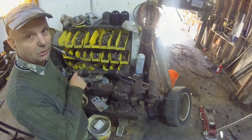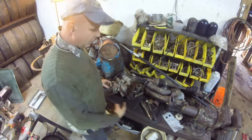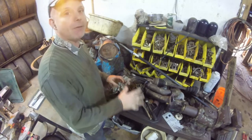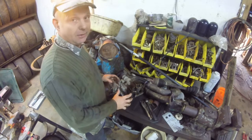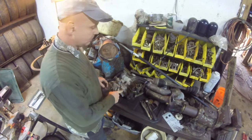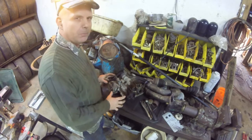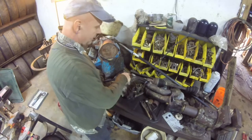Here's the transfer case. In their infinite wisdom, there is no fill port on the side of this transmission to change the oil. When I took the oil out it was goopy, black, and sooty. If you look on the web, everybody has a problem because they say this is 'lifetime use' oil — that is a bunch of garbage. If Ford or Jaguar said it's a lifetime thing and the component fails because you couldn't change the oil, that is really crappy engineering.